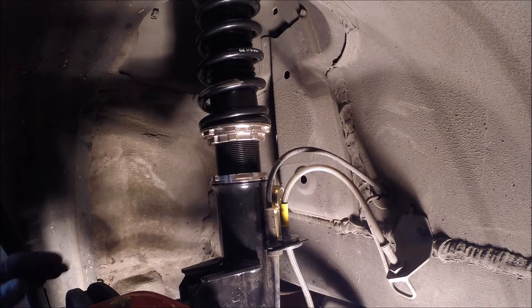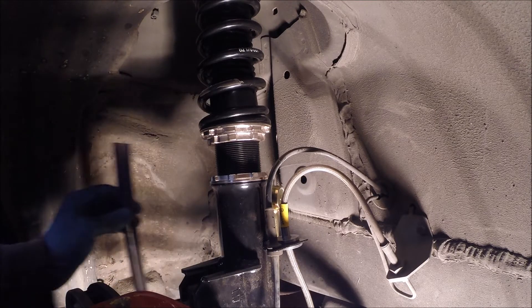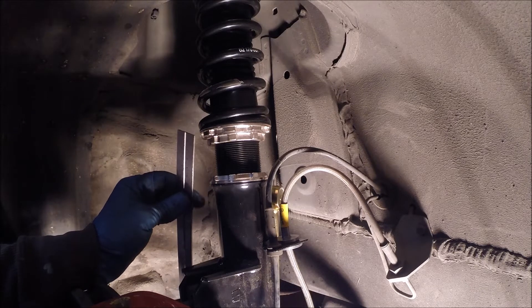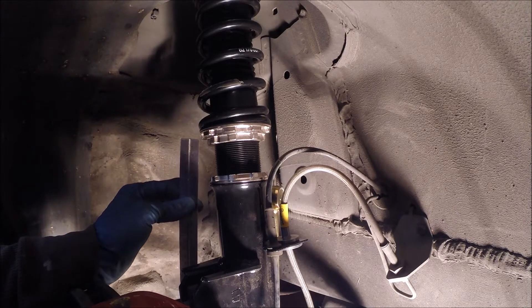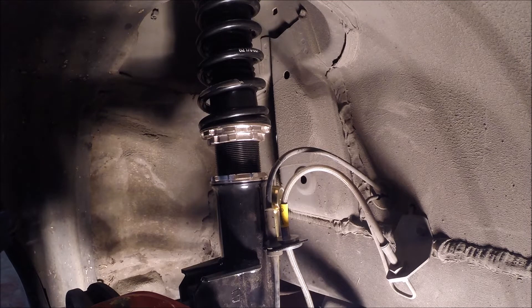Here on the front right corner with the wheel off — when I put a ruler against the bottom of the top locking collar and measure to the top of the base, it's 53 millimeters, with the ride height being 333. On the other side I raised it until it was 65mm, which should bring us up to 345 millimeters. I'm going to try 350 first, but I'm not sure if there's a direct one-to-one translation to ride height, so I'll take it little by little.